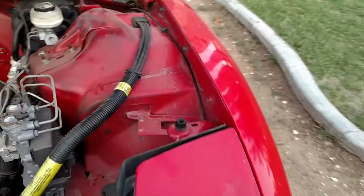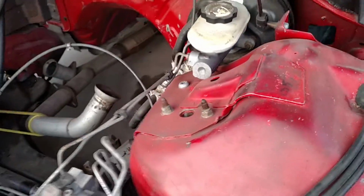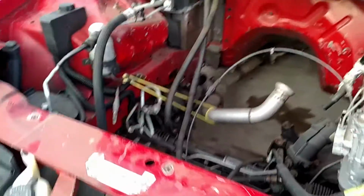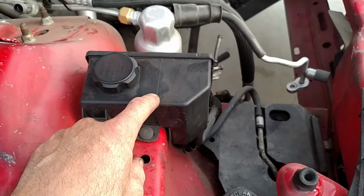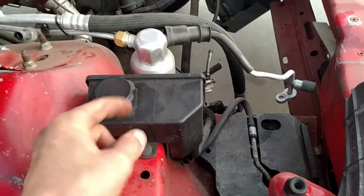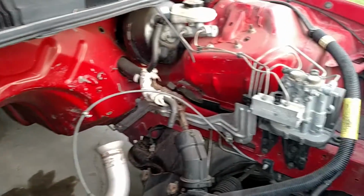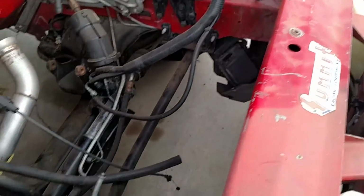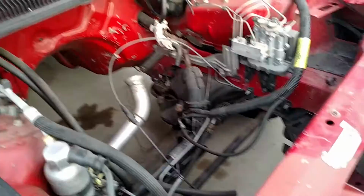So like I said, these fuel lines no longer come through the chassis right here. So I'm going to be probably getting a piece of sheet metal and welding that into place. And then also what I've noticed so far is that once I remove this, there's a small indentation on the frame here that I'm going to cut out from the other car and weld in for the cruise control module. But other than that, that's so far what I've noticed that has to be changed. I want to start with 2 gutted cars, and this is basically going to get the subframe pulled out of it next.